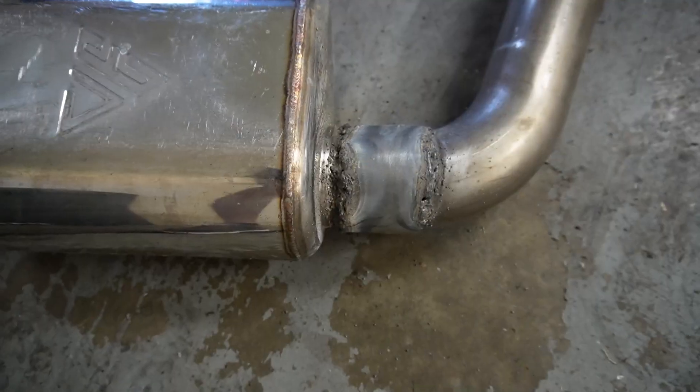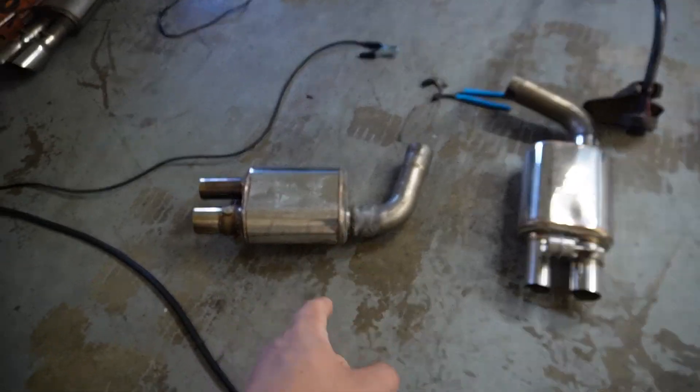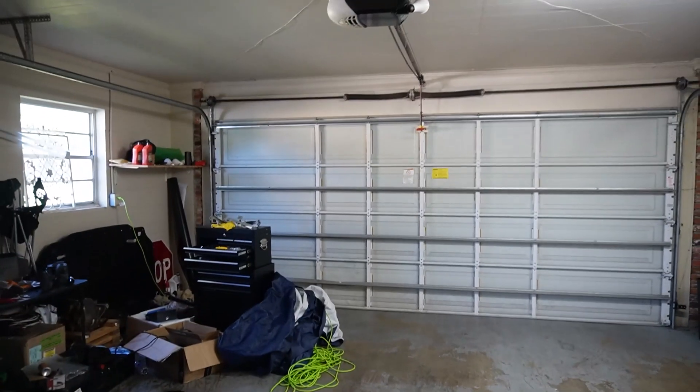It's another day. I just finished welding up the last muffler. Honestly I don't even want to show you guys, that's how bad it looks. I ran into some issues with the way I cut the pipe — I didn't have a sander or a perfectly straight edge, so there was quite a big gap. I decided to just get another pipe that's slightly bigger diameter, cut it, loop it over the pipe, crunch it down, and then weld all around it. It works temporarily — that's just how I'm going to leave it for now, as long as it doesn't leak. I'm going to do some final touches with the welding gun and then put it on the car.